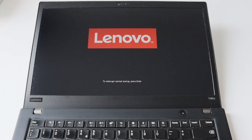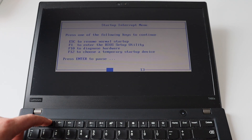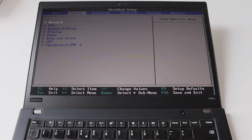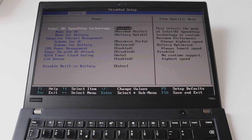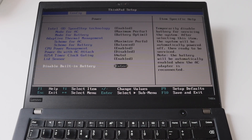The first very important step is to disable the built-in battery. Turn on the laptop and immediately hit Enter to show the startup interactive menu. After that hit F1 to enter the BIOS setup utility. Go to the Config tab, select the Power option, and you'll see a menu with an option to disable the built-in battery. Confirm that you want to proceed and your laptop will be turned off.